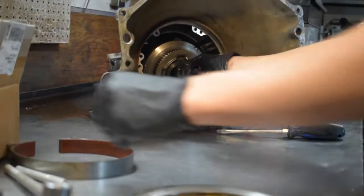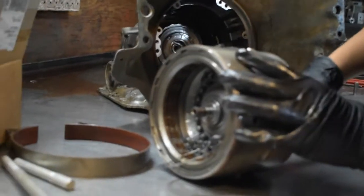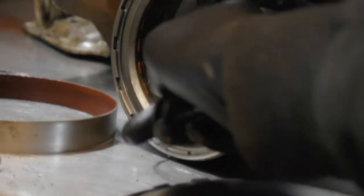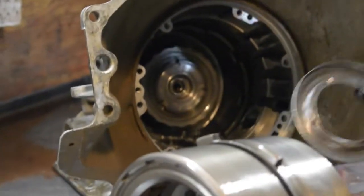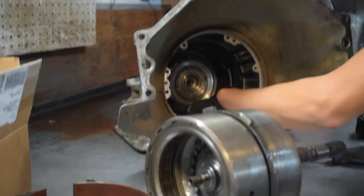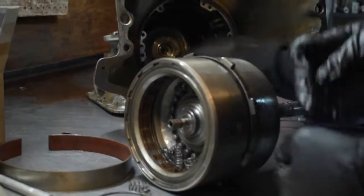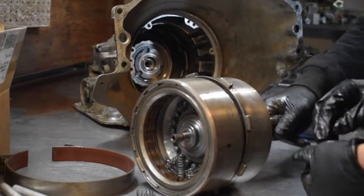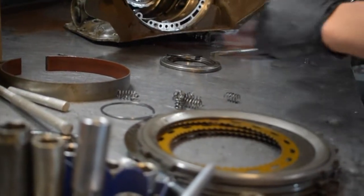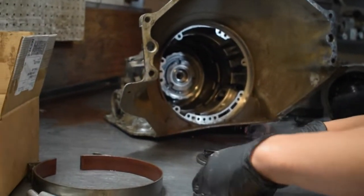Let's pull out the whole assembly. The band looks good. Oh, that's not good - look at that. The snap ring came off and all the springs are everywhere. That's a little different, I've never seen that before. The snap ring is gone - it's piled into the flush washer on the top part of the springs. So that'll be our problem. The piston is damaged - well, the piston looks okay at least.